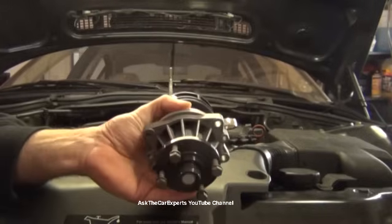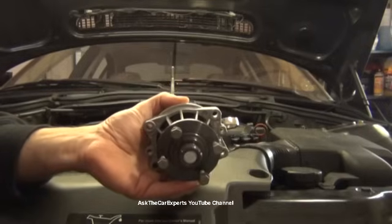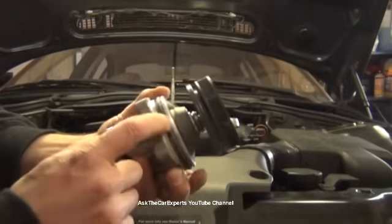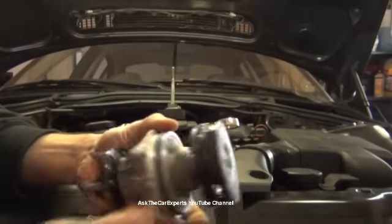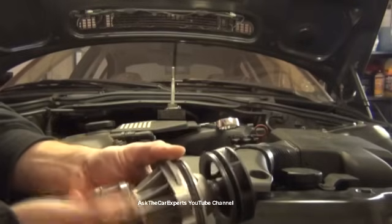Today I'm going to show you how to replace a water pump on a BMW 3 Series or any vehicle with the M52 or M54 engine. This is the water pump right here, and you can see it has a rubber gasket here, and this is the impeller end right here. It's belt driven, so the belt with the pulley is what's going to drive the impeller to circulate the coolant